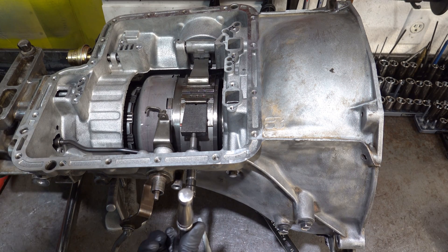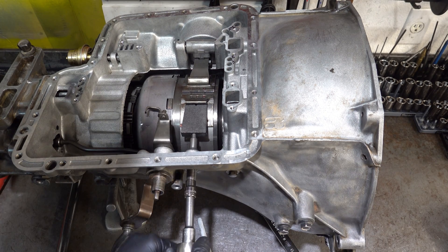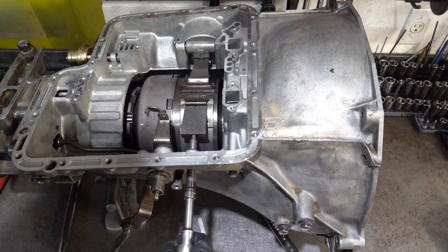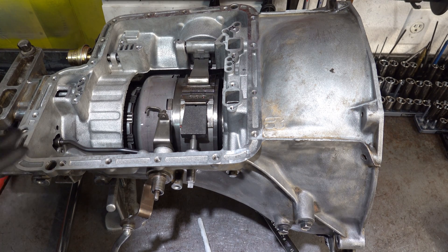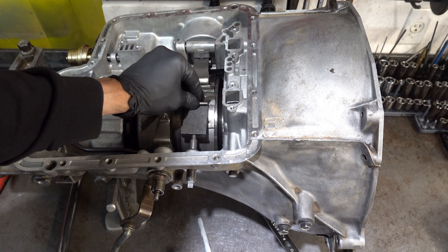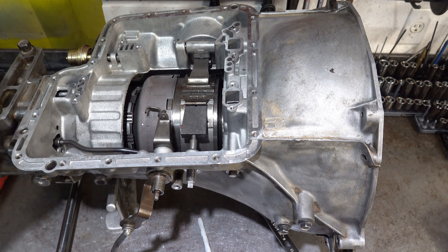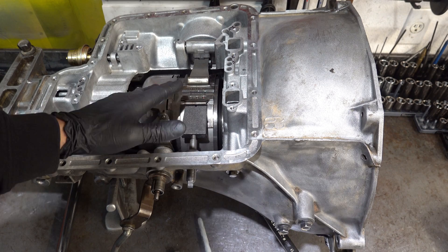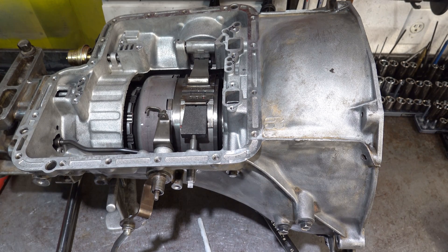Let's start our back out - we're at 12 o'clock. There's one turn and there's the half turn. Now we want to assess the band clearance and get a general feel of things, so go ahead and wiggle each side of the band. This feels about right to me - that's typically what I see when I put these things together. It should have a little bit of movement, a little bit of travel, but it should not be super loose and it shouldn't be tight or bound either.